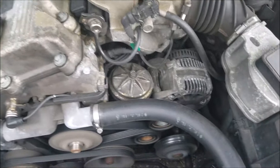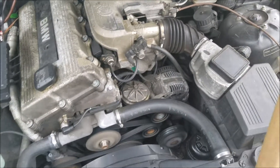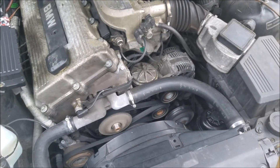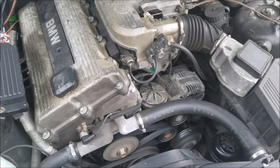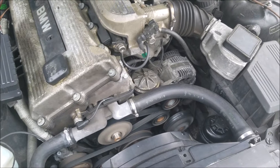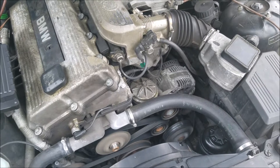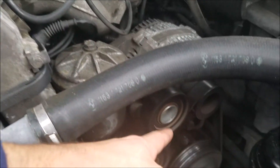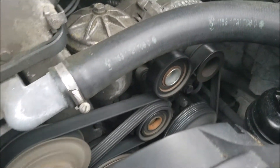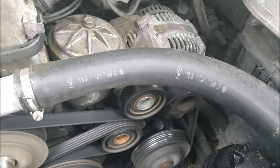Go ahead and rev it up. You hear that noise? It makes that squeaking, bad bearing noise more when it's really cold outside. He's noticed when he revs up the vehicle a bit it makes it quite bad as well. I'd already replaced the water pump before and I've replaced this idler pulley right here — it was making some noise — and so now the rest of the noise seems to be coming from the alternator, so I'm going to go ahead and replace that.